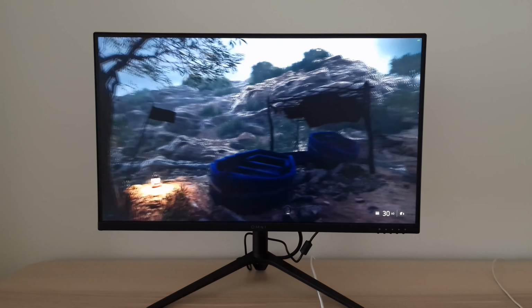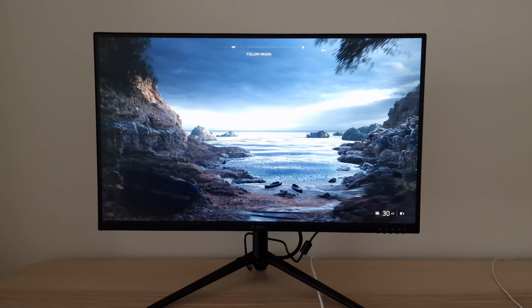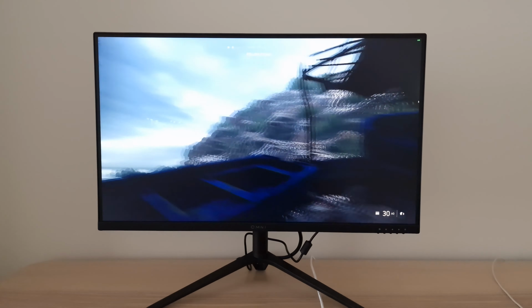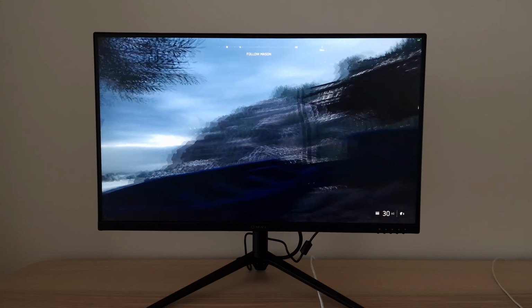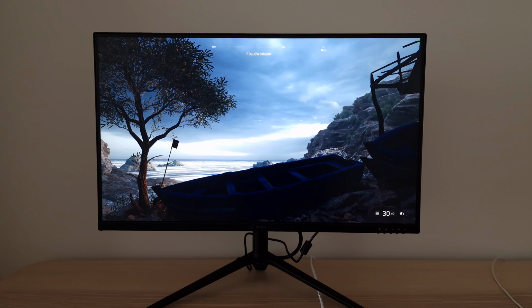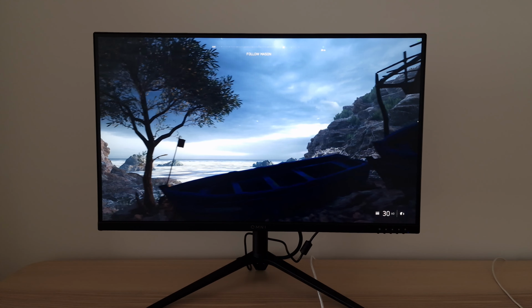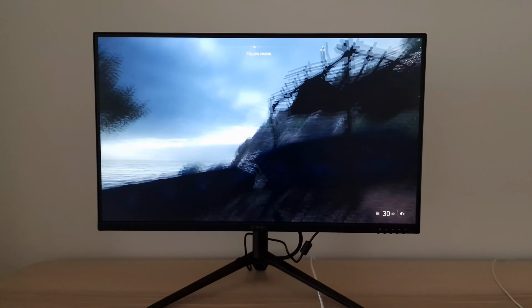But there's certainly a big difference between 165Hz at a good high frame rate and 60Hz. The 60 FPS experience, very big difference there. This high frame rate, high refresh rate combination brings you two main advantages. It improves the connected feel, which describes the fluidity and precision you feel when you're interacting with the game. This monitor also has an exceptionally low signal delay, low input lag. I measured a bit under 2 milliseconds, so that doesn't impede the experience. It's really good in that respect, a nice responsive feel.